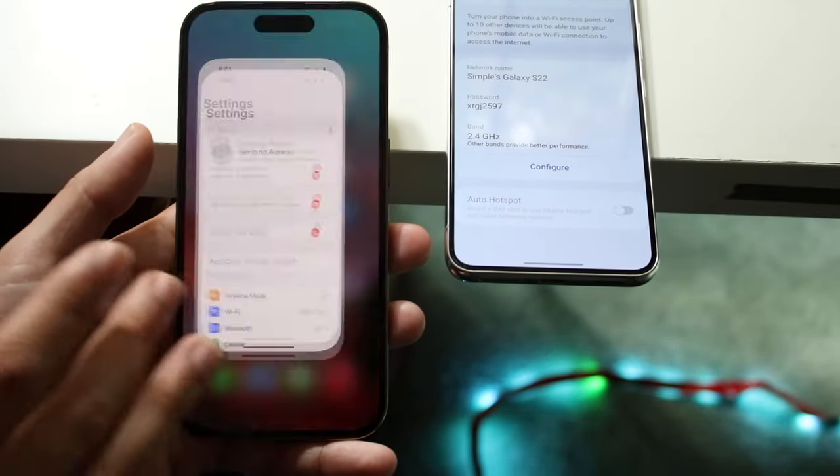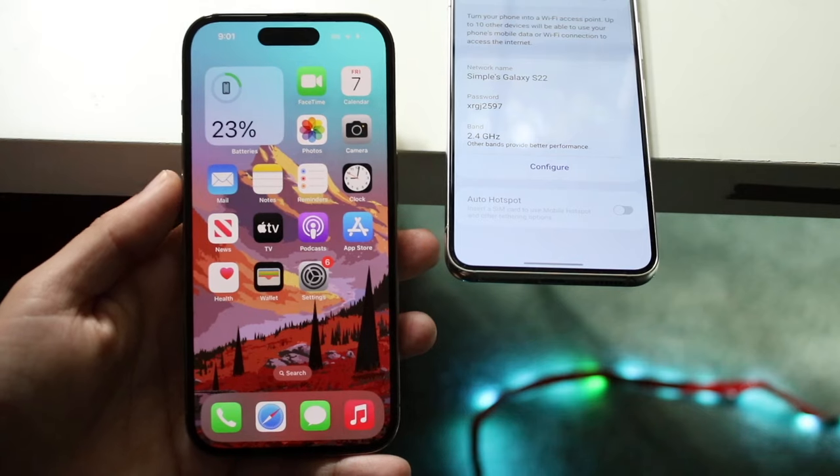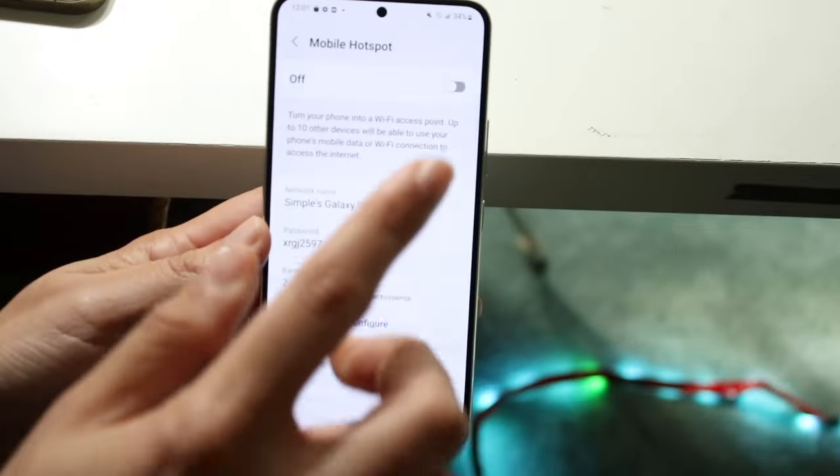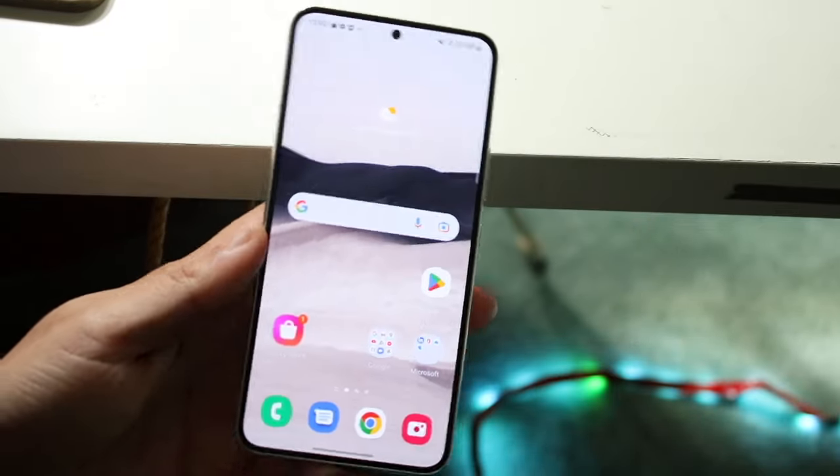You should then see that your Wi-Fi connection is working on your mobile hotspot on your iPhone or laptop — whatever you're using. That's pretty much how to do it. To turn your hotspot off, just go back to your Android and click the mobile hotspot off option — that's all you have to do.